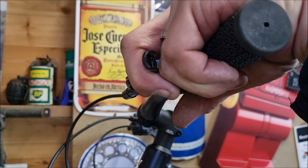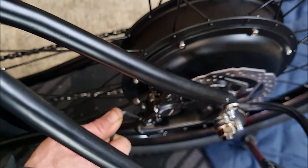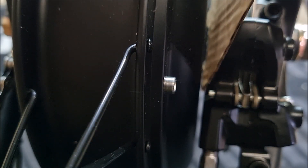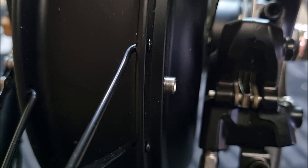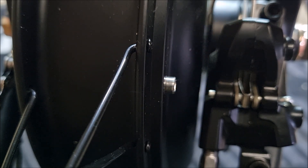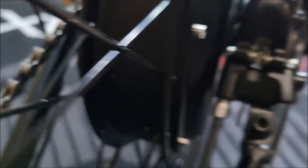Re-aligning the caliper, I was amazed at the space I had between the caliper and the hub. Previously it's been like two or three mils if I was lucky — you could barely fit a piece of paper between. This was a larger hub, yet it had better caliper clearance gap — I would say about five mil.